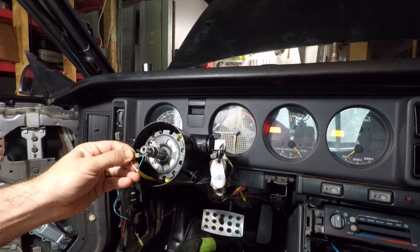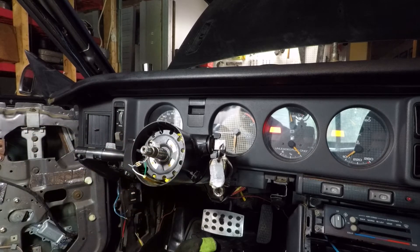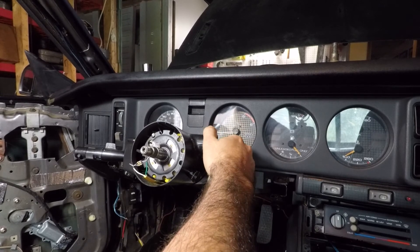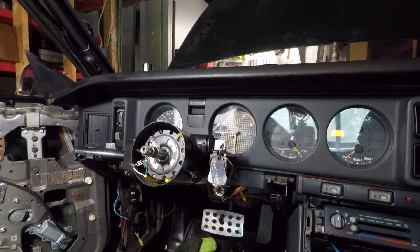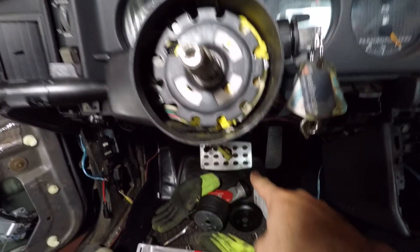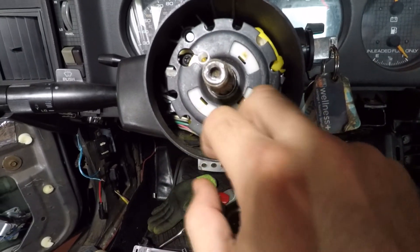There we go — and I disconnected it. I twisted it together and it looks to be off. Let's see if I turn it off and back on again — if it just blinks and then immediately stays off. There we go! To wrap up the airbag thing, rather than having the resistor appear on the wire, I moved it down to that yellow plug that's dangling. It's a little bit cleaner and I don't have to worry about it bouncing around.